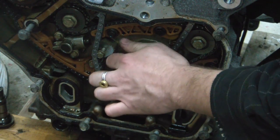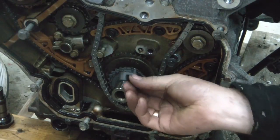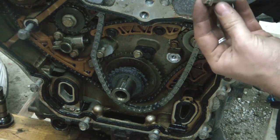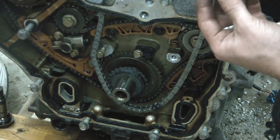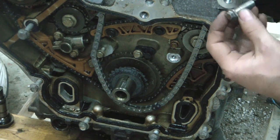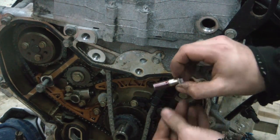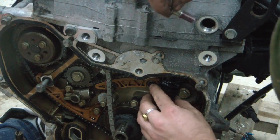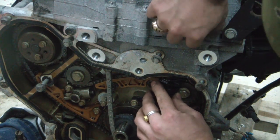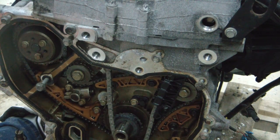We're going to get this old chain oiler changed out for a new one. This is a new design that has a little bigger port for the oil spray pattern to better oil the chain at lower RPMs. Here's our new chain guard, and this is the new bolt we had to make. I'm not sure what the torque spec would be for that but we'll do it the same as all of them. We put a lot of red Loctite on this bolt and I'm going to install it in the upper location — I don't want this to back out and destroy this again. This one also came out and broke, so it will also get some Loctite.